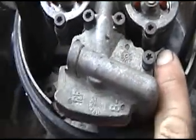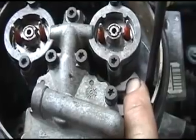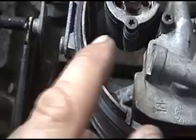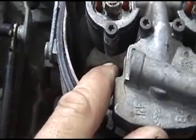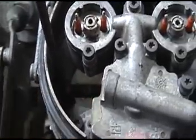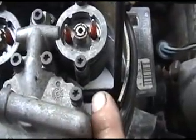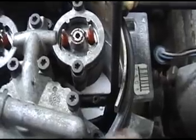What I noticed, as I was sitting behind it, which in a regular vehicle you're probably going to have to sit on the other side, was that the left side cylinder spray pattern was thinner than on this right side. Well, the right side plugs were saying it was running a little bit richer.